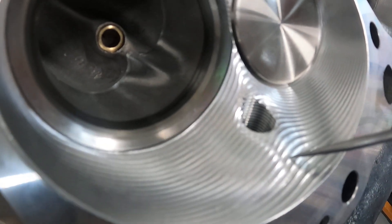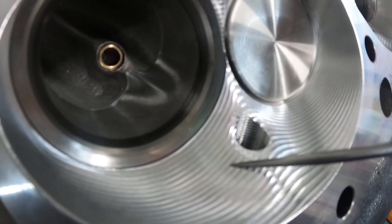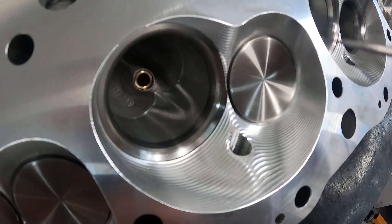On the 121cc version, the CNC lines are much smoother — you barely see a line, that's kind of the point. The reason these are cheaper is because it takes less machine time to cut this than it would to keep doing smaller and smaller steps to make the finish smoother. That's why.